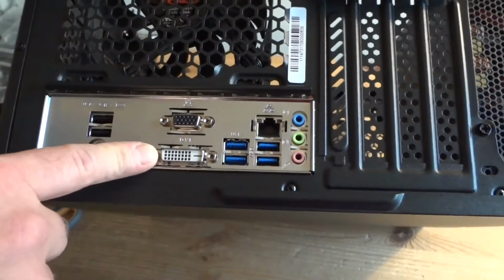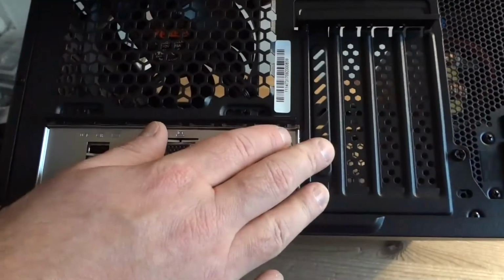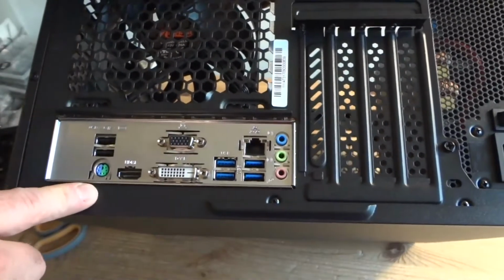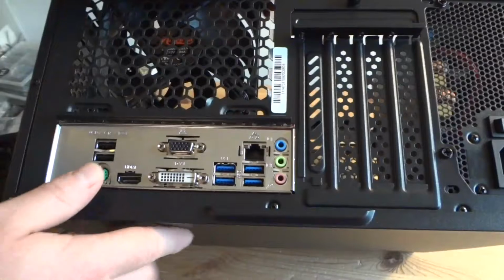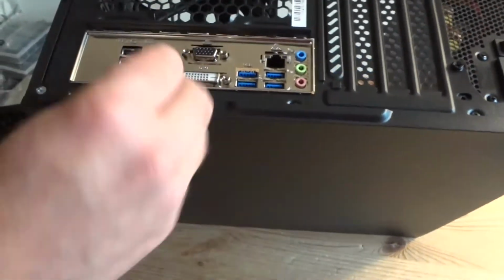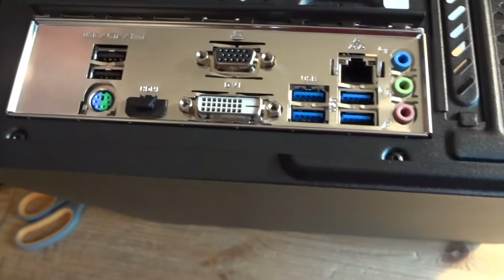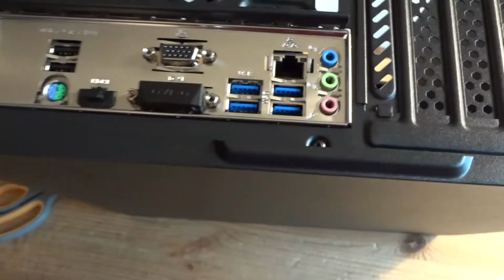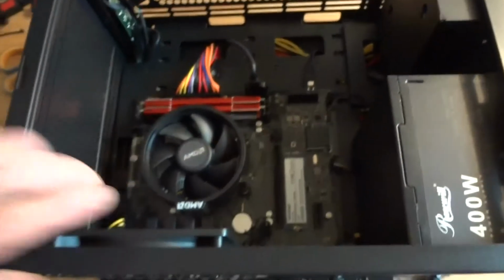And please remember it, it's important because some people with computers like this with a dedicated video card that we're going to install here now, they try to use these ports and they don't work and they complain that the computer doesn't output any video, and the reason is because they're using the wrong ports. That's why I'm going to do something like this. Let's see. Boom. Put it here. Try to close them, or sometimes I would use duct tape so people would not try to plug anything into them, because we're gonna have a video card in here now.